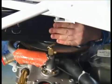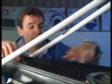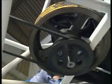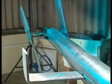The engine here will drive the primary shaft with the belts on. These will take the rotation back to the secondary shaft with the big pulley on, which connects with the tail rotor. Then through that secondary shaft, the little cog on top and the chain drives the big cog here, which drives the main shaft and the rotors. But what if the engine fails? Well, thanks to the freewheeling sprag clutch in the secondary, as the blades continue to rotate with the engine stopped, you can keep your tail rotor turning — which means you have complete control over the helicopter to get back down to earth safely.